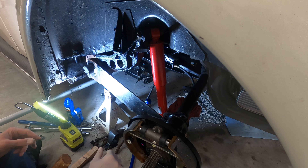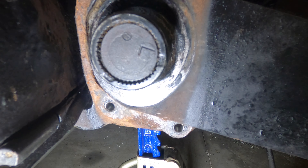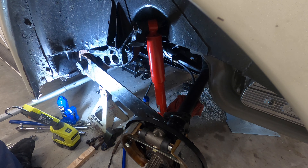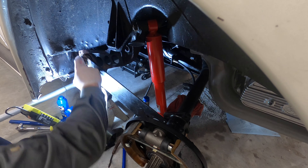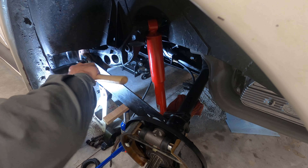I'm reversing what I did — I originally dropped it but wanted to raise it back up. If you're going to drop it, take the torsion bar off gently and raise it up one tooth. If you want to increase the height of the car, you want to drop it one tooth.